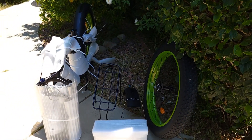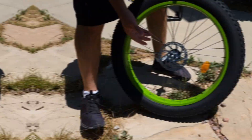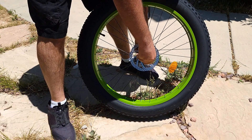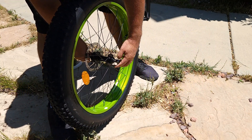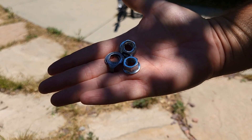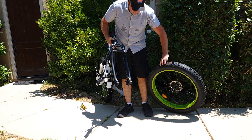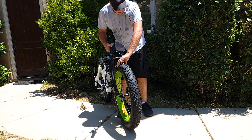I'm going to show you how to install the wheel, handlebar, and fenders. Here's a life hack: first you need to remove both nuts from both sides including the locking washer. Do the same thing on the other side — completely remove the nuts. This way it will be much easier to attach. Then bring the fork up, remove the protective cover for the fork, and insert the wheel — it should be very simple since you already removed the lock. Make sure you insert the brakes between the two pads.